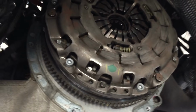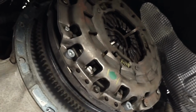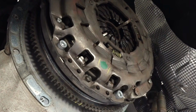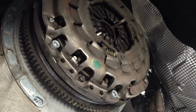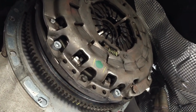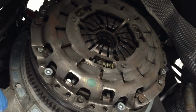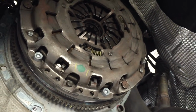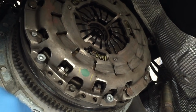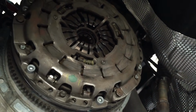And the engine on the back has had a rear main crankshaft oil seal. Original flywheel and clutch, because there's history of that being replaced, I believe the owner said. New release bearing though, because there was too much grease on the old one and it looked like it had been snagging and also digging into the fork slightly. We've obviously renewed the flywheel bolts for genuine BMW ones with the Loctite, and also a dowel, and also clutch bolts with the BMW Loctite ones. Used the BMW tool as well.